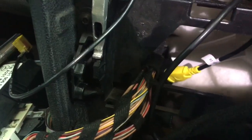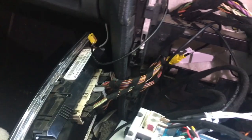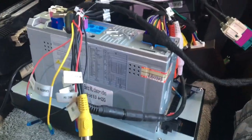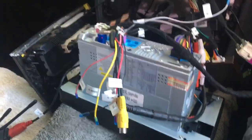generic Apple CarPlay adapter, which comes through on a 3rd USB. So the one USB goes to the Apple CarPlay adapter, and the other one goes to a flash drive or external memory. So apart from the few lessons I've learned, it's fairly straightforward, and it sounds great. Now I'm going to tape it up with cloth tape, make it neat, and wrap up the job.